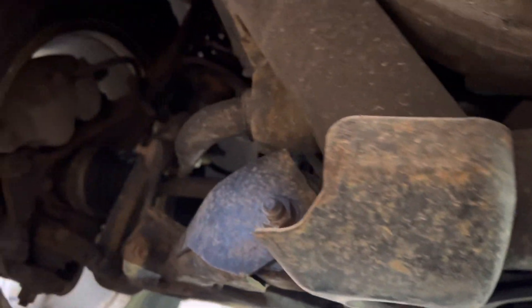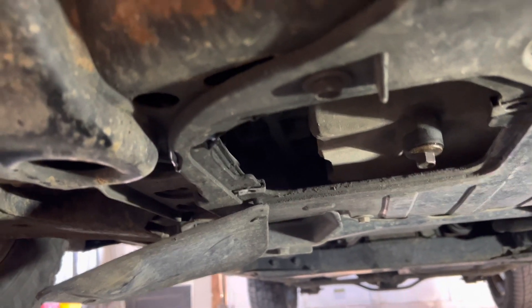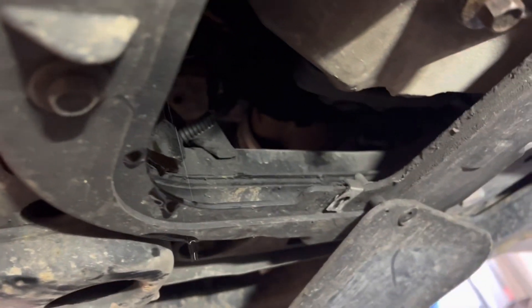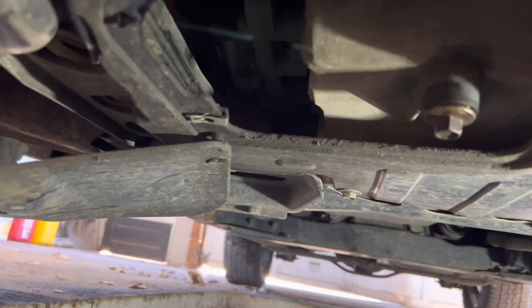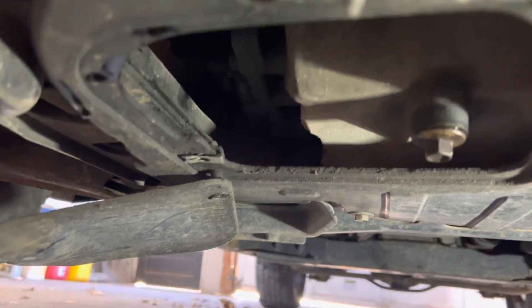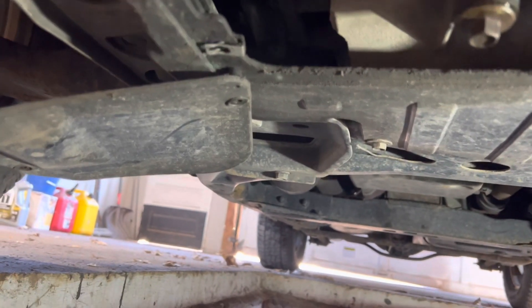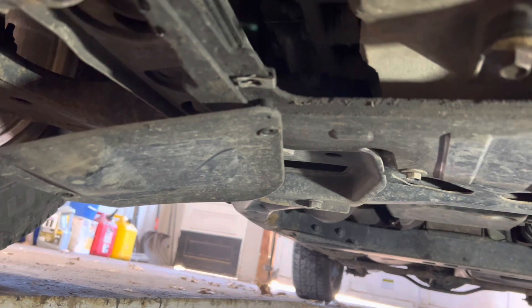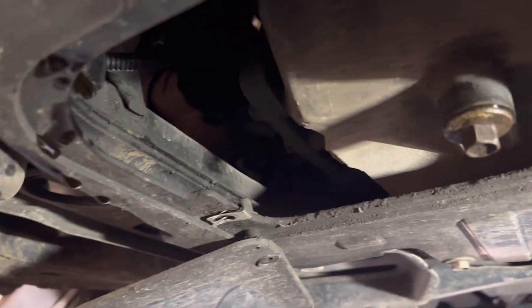This is kind of in good shape for what it is. I let the oil finish draining and I put the drain plug back in. This is one of the flaws of the Trailblazer — I feel like they could have really put the oil filter in a different location, because there is a little bit of oil left in there and it's draining everywhere, so that's something you're gonna have to clean up. Whenever I put the new one back on, I put a little bit of oil around the rubber o-ring, make sure the o-ring from the old one is still not there, and then just hand tighten it on. I struggled to get this filter off too — apparently whoever did this oil change last felt like it needed all of the torque.